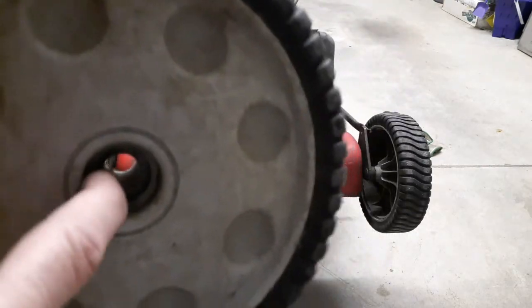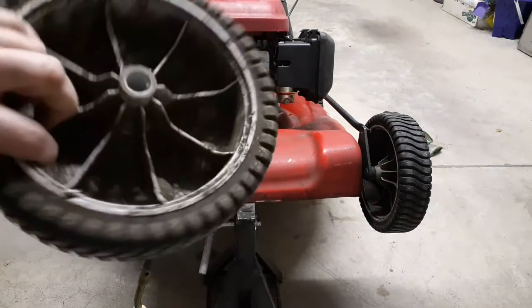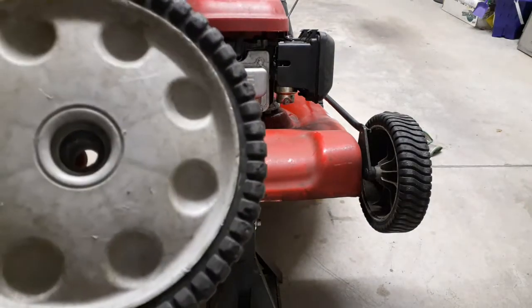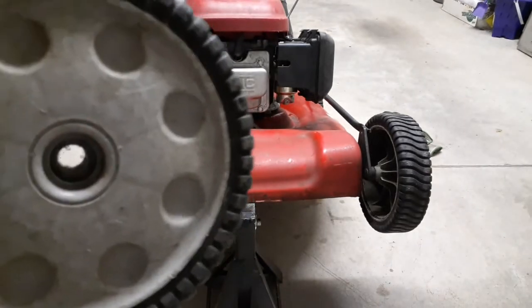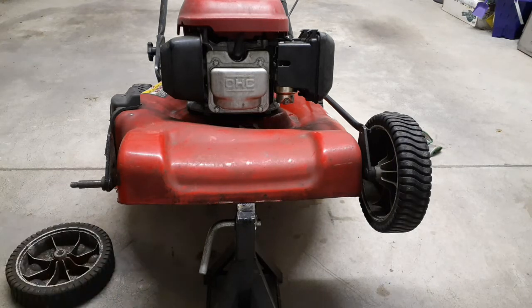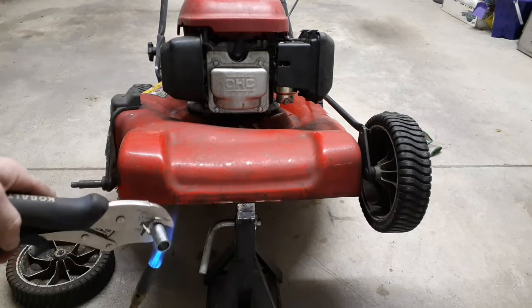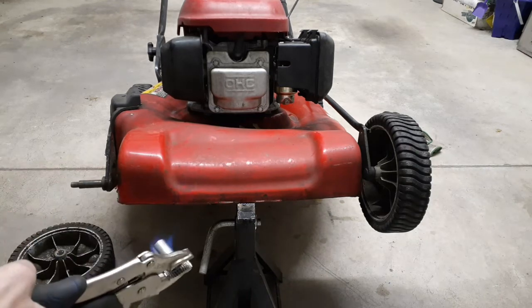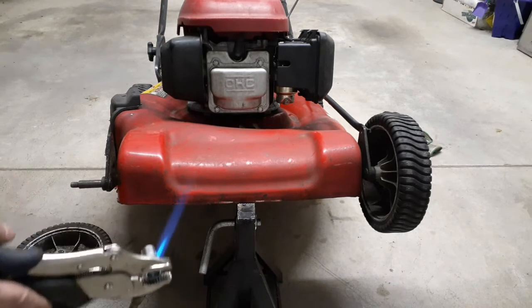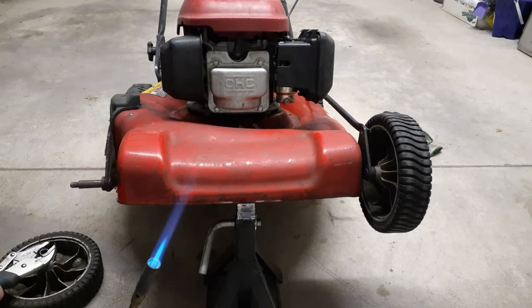Also check to see if it goes right to the edge, or sometimes there's a little stop where the bushing seats. In this case, this one never came with a bushing in it, it was just plastic. So what I measured, it's going to come out to this side. Get some heat. Heat the part. Test it out. It's just about there. Push it down.